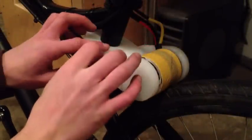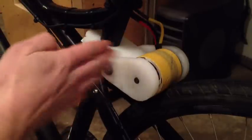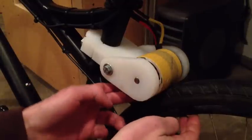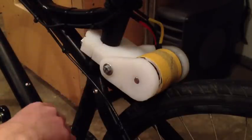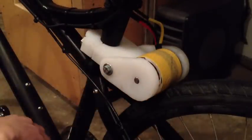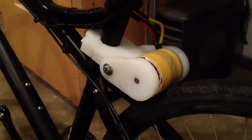The way this is set up isn't exactly how I originally designed it. I wanted the main mounting bracket up higher with the motor swinging below it — the inertia of the motor starting would swing it into the tire, and once it hit the tire it would want to climb through the angles, engaging harder and harder. When the motor shut off it would swing back out of the way and you could pedal normally. The reason I didn't do that is I don't quite have the room on this frame — this little gusset gets in the way and the seat post clamp would require remachining. So for now I have it the other way, and I like it because I'm mostly going to run with the motor on since it's fun zooming around at 50 kilometers an hour.